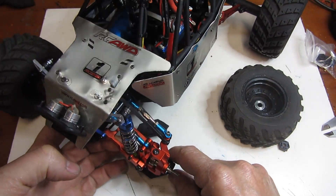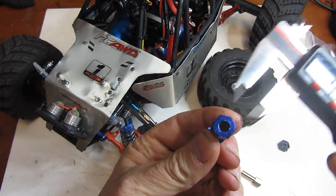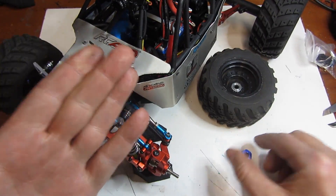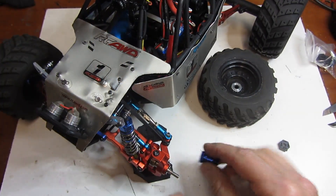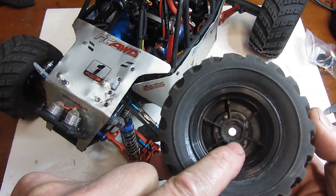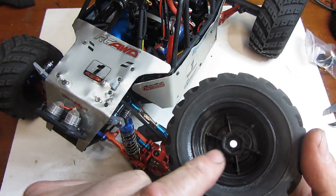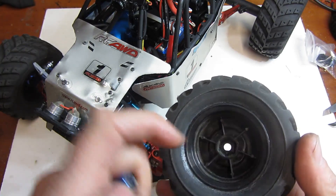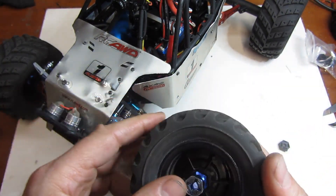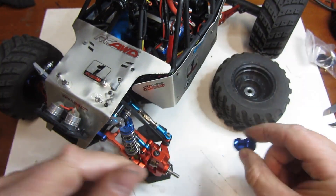The last thing you would probably need to know is exactly what hub size you have. This is a 12mm hub, which means this piece right here that goes up into the wheel, measured flat to flat, is 12mm. Those are the three things you need to know to buy the proper hub extender: the length you need to achieve the proper clearance, the thread size on your axle, and the hub measurement inside of the wheel. Make sure you measure the wheel you're going to put on, not the stock wheel you took off — these happen to be the same, but you could get an aftermarket wheel with a different hub size. You need to buy a hub extender that fits tightly. 12mm is a standard size; they also have a smaller size — I think it's maybe 9 or 8 — and then one step up I think it's about 17.